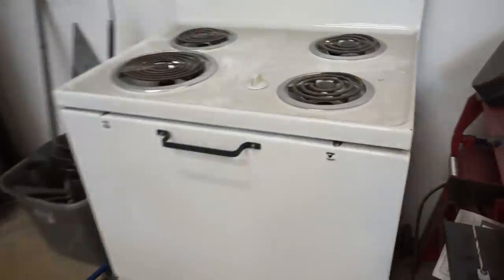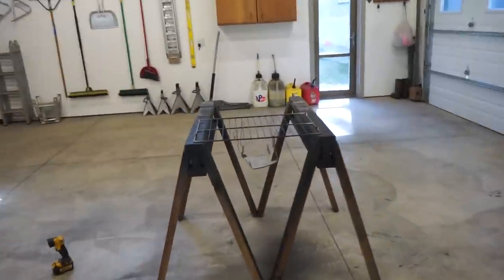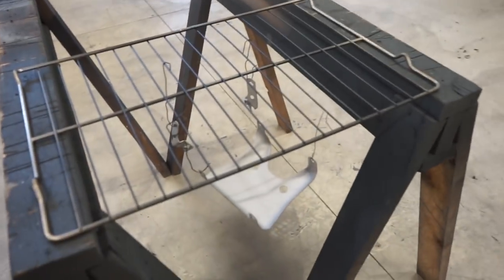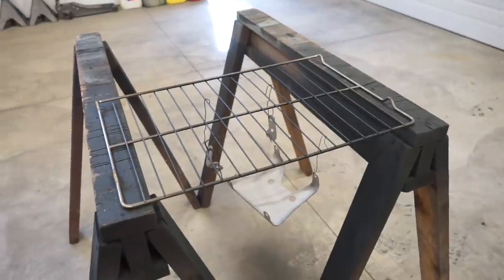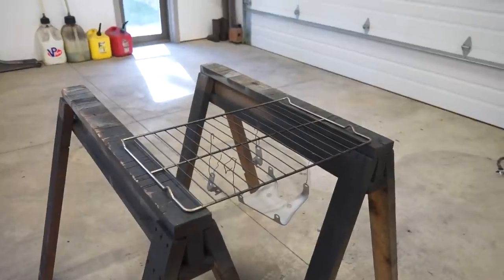All right guys, this last spindle is just about done. We got a few more minutes on timer, but I got a couple other little things I wanted to get done. There's those little brake line clamps for the spindles, and then that's the transfer case little skid plate deal. That was all rusty and full of crap. So once that other spindle is done curing, we'll coat these ones and we'll be all done powder coating.